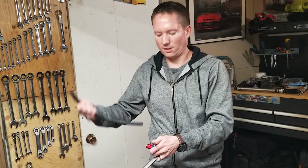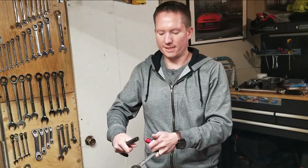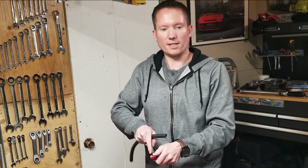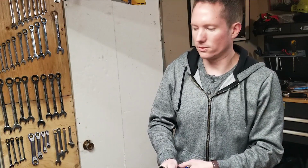So essentially you need one hand for your hose, pushing it into the fitting, preventing it from pushing out. And you need two hands to tighten the compression fitting to handle both wrenches as you're tightening down. So obviously that's not very practical for most people unless you have a friend helping you out, then you might be able to get away with that.